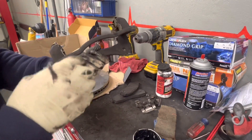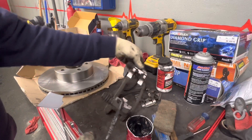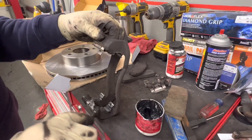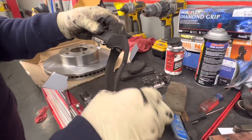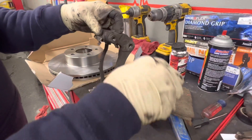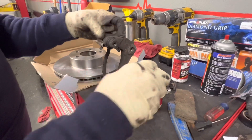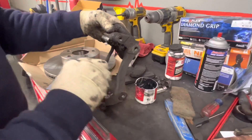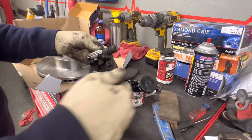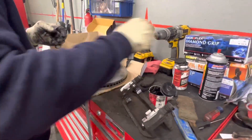These can be sharp so be careful. Those are all locked in now. We're going to lube up the tracks — the slides — with brake pad slide lube. Normally at this point I'd put the brake pads in here, but these are just being a pain. It's easier to put the bracket on the vehicle after the rotor is on and then slip the brake pads on sideways. The bracket is all set: pins are done, clips are in, we filed the inside slides, clips are on nice and tight.